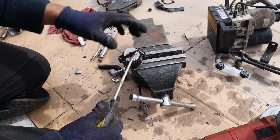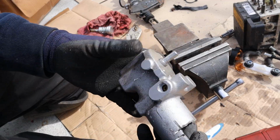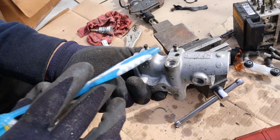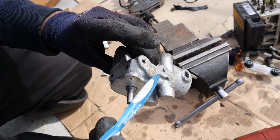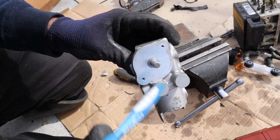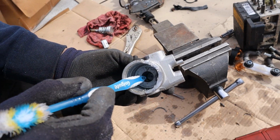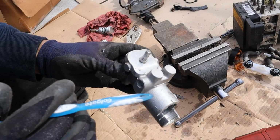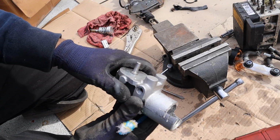Oh, it's just a coil. What did I expect? This is some sort of a pressure sensor. Taking a look at the layout here, you can see we've got our input over here and our output over here. We have fluid that's going to be drawn in through the oil galleys over here and then sent around the sensor over here and these two ports over here. Looking down inside of here, there is a slot, which is what's going to pressurize that piston. Now the rest of the fluid is going to be sent back out through the output to the ABS module